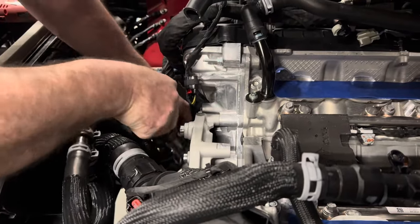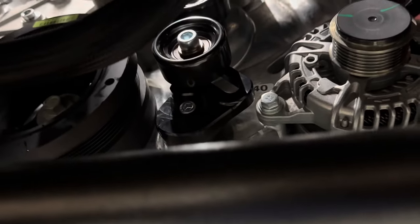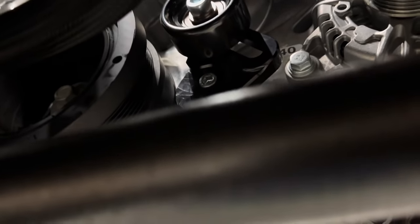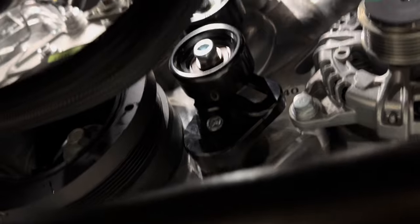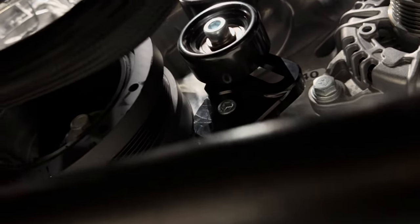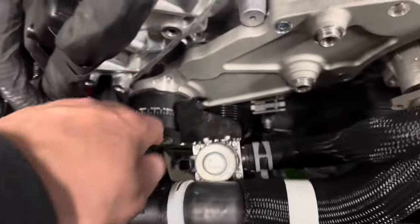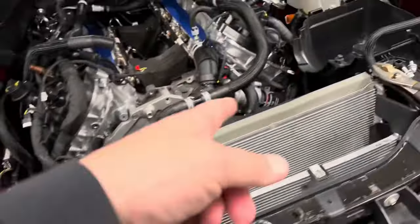You hear a little click, you know you've reached your pre-set torque setting. Your factory system comes with a spring-loaded tensioner that sits right here. On the Whipple system, it comes with a fixed tensioner and also a spring-loaded tensioner, so you get two tensioners and a little more belt adjustment. You can loosen this and get quite a bit of adjustability, and then we'll have the spring-loaded tensioner as well. You get it close with the manual tensioner, then let the spring-loaded tensioner take over so you don't over-tighten and put extra stress on the crank. We're also relocating the ground wire up here from where it was down here, and the spring-loaded tensioner is going to be on the front passenger side of the vehicle.